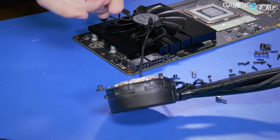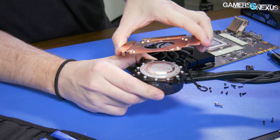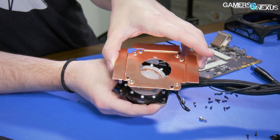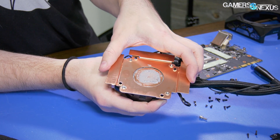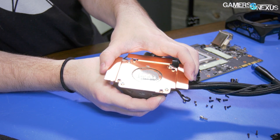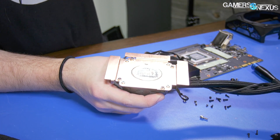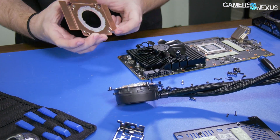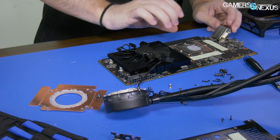There's all the thermal paste that connects the VRAM plate to the GPU plate - this actually does help. The reason it helps is because you're sharing the liquid cooling solution with the VRAM, and you only really need the GPU to be so cool anyway. Once you're in the 30 to 50 degree range, it's fine to share some of the cooling solution with the memory, which can make more use of it. This elbow bracket at the end is also new, and so is this other piece here.